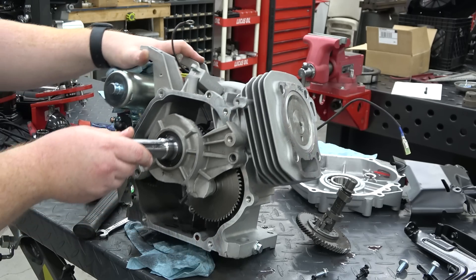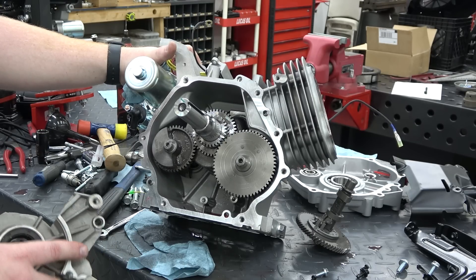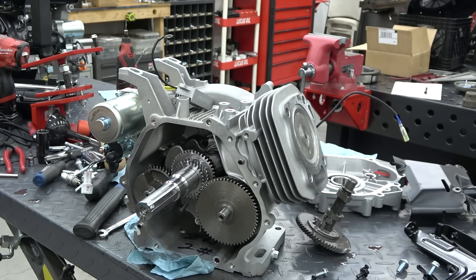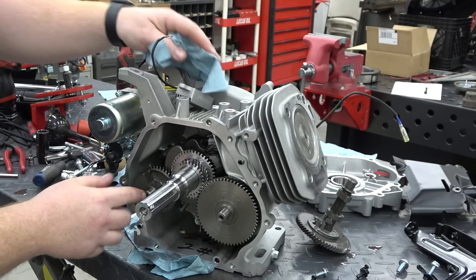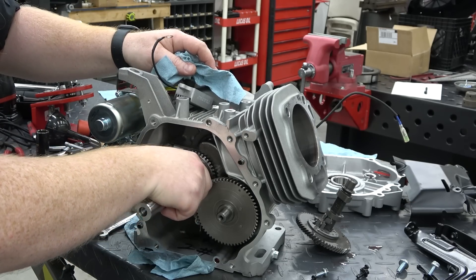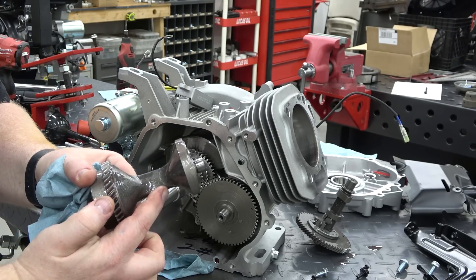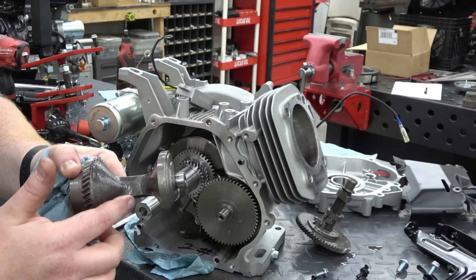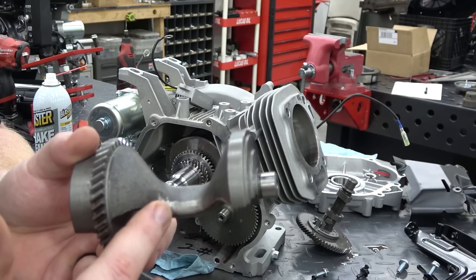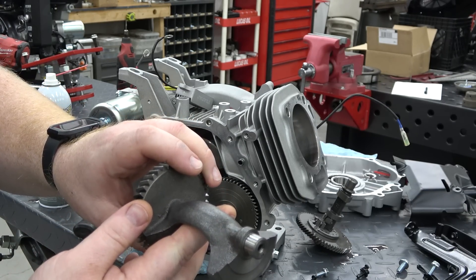This does have a different side cover. I was going to test with my cutaway side cover, but I can't because the bolts don't line up over here. That is disappointing — only for the billet side cover. We might need a billet side cover later with boost, but right now we can't run it. I was wanting to check clearances. The only clearance I worry about is when the rod comes around and it touches the balance shaft. So I'm going to go ahead and pull the balance shaft out and take some off the edge here and there, just to clearance for that rod coming around. I did grind out where the dipper was coming into contact. So hopefully she's all good to go.